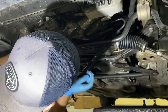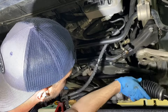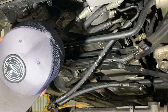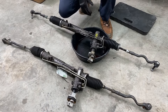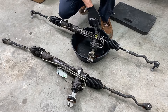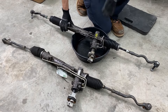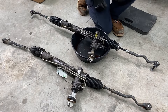I think I'm going to have to separate that column a little more. Wow, that came out pretty easy. The subframe looks to be in good shape — I don't see any issues to why we would have any play in the subframe there, so that's good news. Everything on these two racks comparison-wise is looking good. The only difference is our color and our tags. The rack that came out of the car is a yellow tag which I believe might be a ZHP rack — you guys are going to need to comment and tell me. But this one's a silver tag. Other than that, the part number for the rack matches so I'm going to continue with the swap. If you guys have any more information on the yellow versus silver tag, please feel free to drop a comment. Let me know and if it's any good stuff I'll pin it so everybody can see.